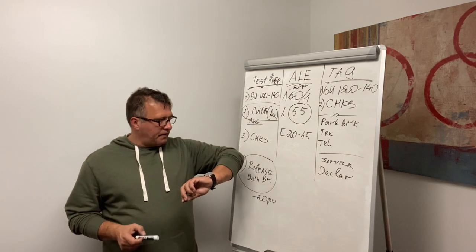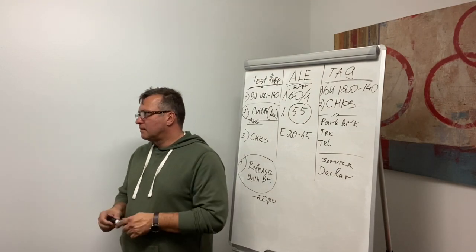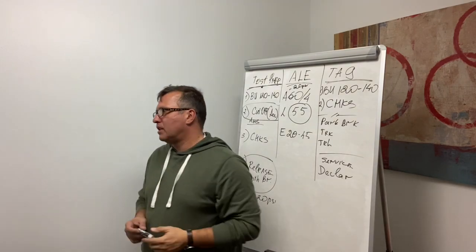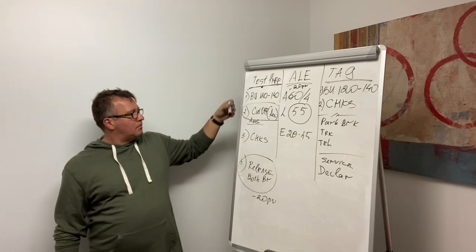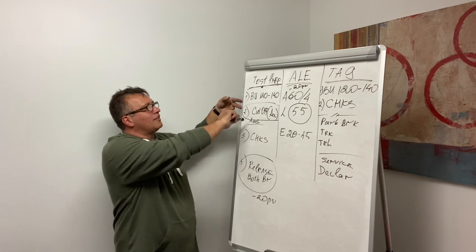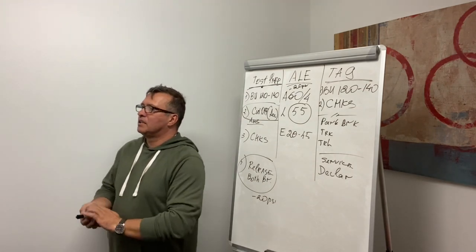All right, guys, we finished a little earlier today, but pretty much that's it. Please work on it, learn it first, put it on paper, understand the order, one follows another. We cannot cut off the engine before we build up pressure, can we? No. We cannot. Chocks, you can check at any point, just make sure chocks are there. Logically, these two go together, right? You cannot cut off the engine before you build up pressure, that's why. One follows another. And here's the same, before you release brakes, just have this paranoia. If I release brakes, the truck can roll.